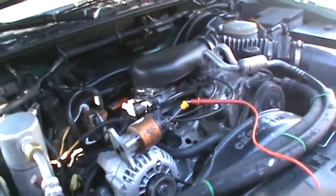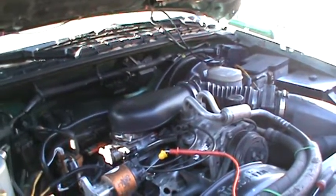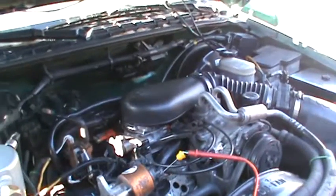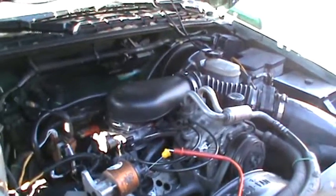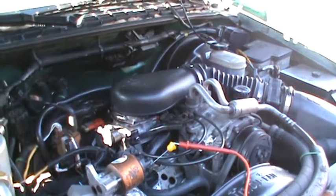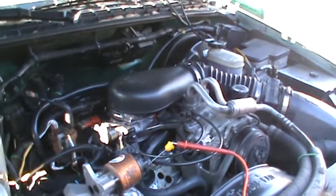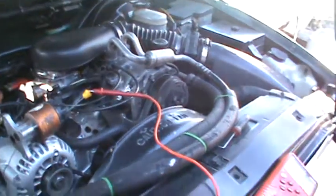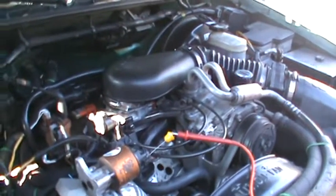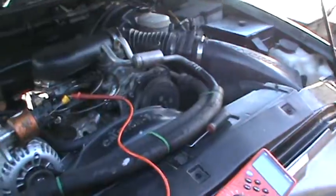That's what it does. But with my scan tool, I can look at the TPS sensor, because it tells me the voltage whenever I'm depressing the accelerator. I can physically watch the voltage go up and down, but I can't do that with this car, because my good scan tool went away years ago. I haven't been a professional mechanic for about 10 years now, so I'm retired from that. I wasn't going to spend $3,500 on a scan tool when I'm going to use it once every 3 or 4 years. So I have to use an analog test, which is what I've done here.